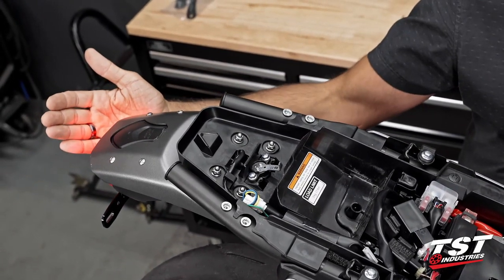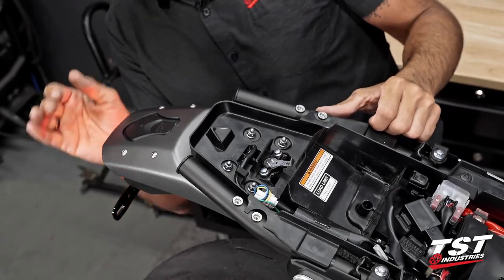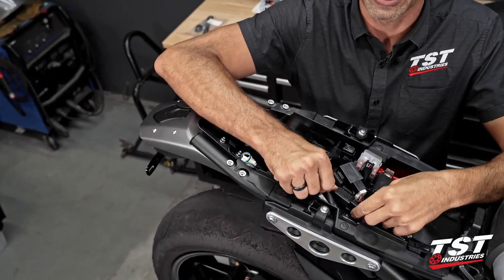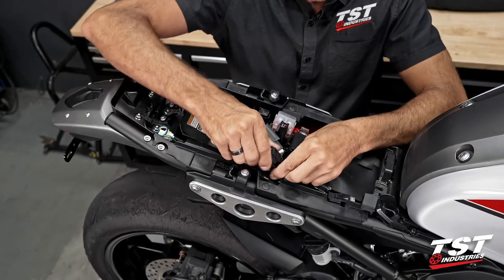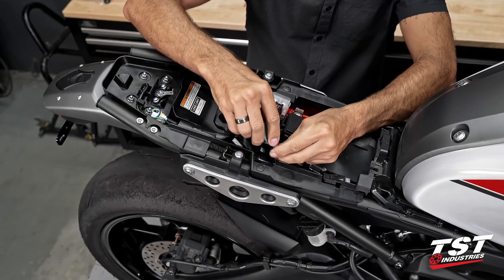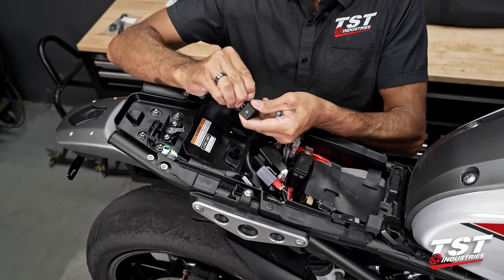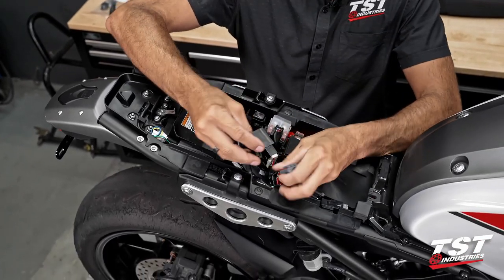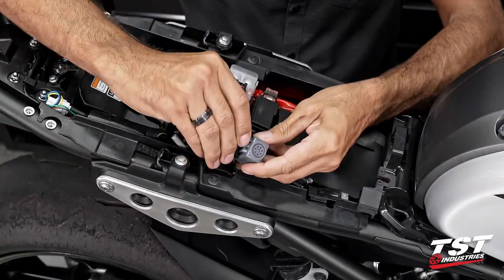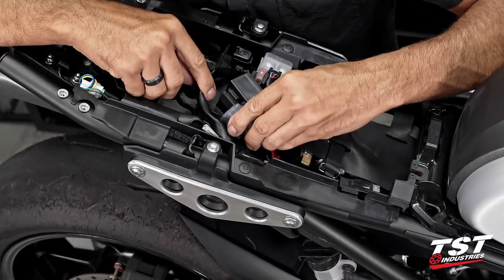Should you ever choose to do one of our TST Industries brake light modulator, this keeps the bulk out of here and you can actually mount it here and connect it through without a big bulky mess. Now draw your attention to the fast flash here — the signal on this bike is actually flashing very fast, and that's the hyper flash symptom I was talking about in my intro. For the purpose of combating that, we would now change this component here — this is our flasher relay. Unplug it, plug this guy in, and we're back to proper flash rate. Then just strip off this rubber keeper — that is a suspension mechanism for keeping your relay on the frame — get the rubber keeper onto your relay and slip this over its receiving tab. And that's that.